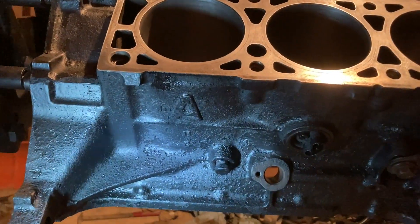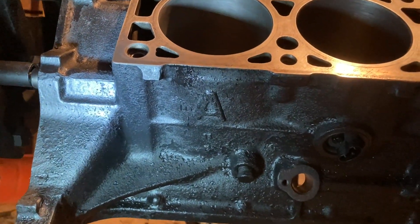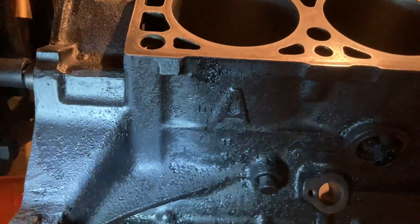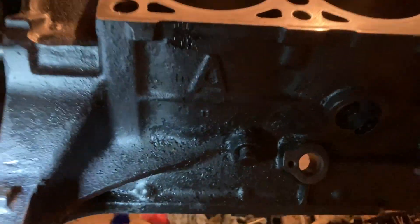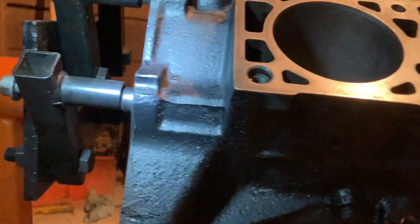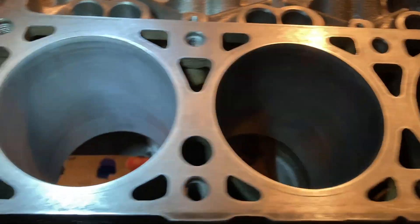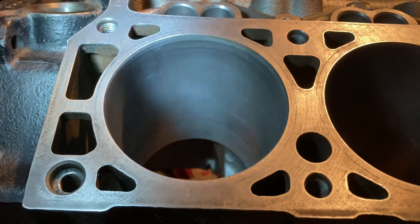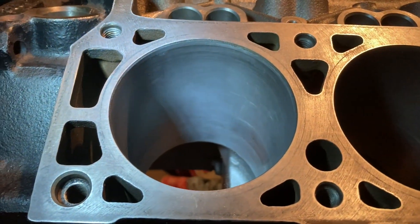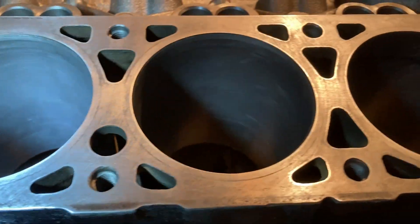It's been a little while since I painted this thing — I was working on the cylinder heads and other things. It's not professional; I didn't scrape off all the old paint, but at least it's all one color now and it'll be protected from the elements. I've also got the cylinders honed. Because I'm using a moly plasma ring, this is done with a 400-grit stone — the standard is 240 grit, which I did first, then went back to 400.